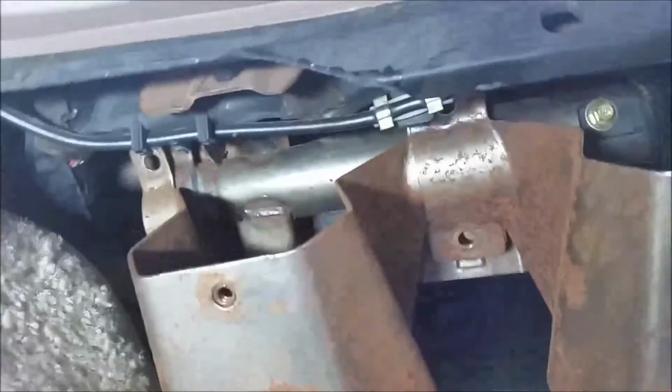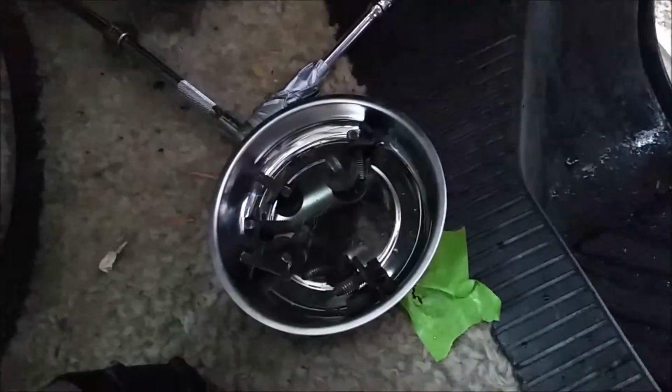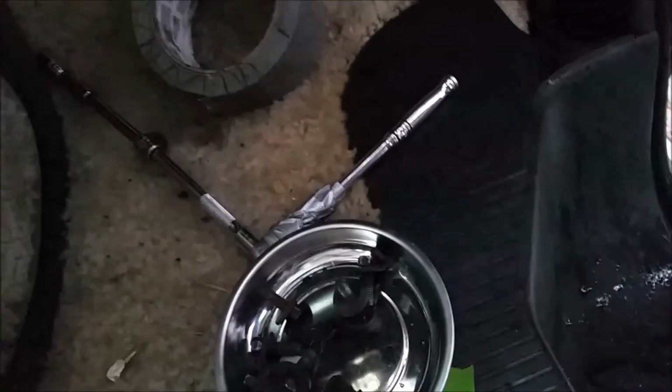And then the bolts that go on here are easily enough done. I already checked all that. And then, so there's a bracket that goes on there, and then a front plate, and then the final cover. So I'll do those three things here coming up. Just so I don't skimp on you, here's the bracket that goes in place, and then there's a plate that goes on front. So they all use all the same hardware, which is sitting right there in my magnetic holder. And they're all 8mm heads, so kind of straightforward.